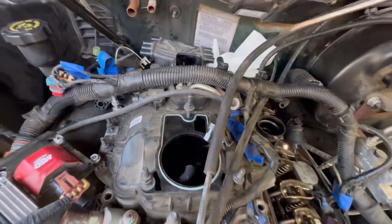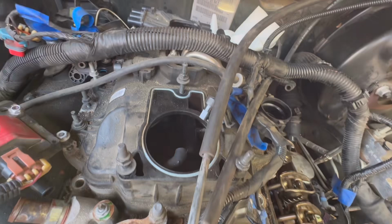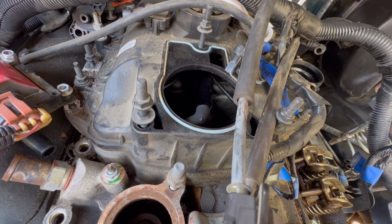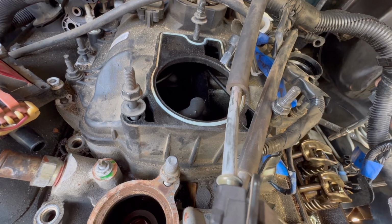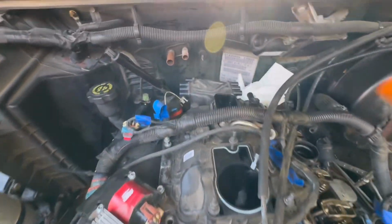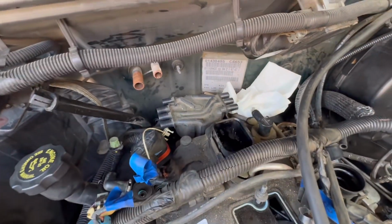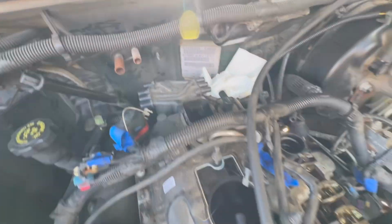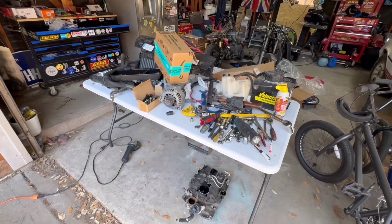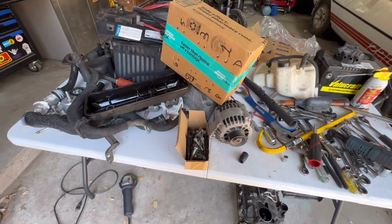So when you go to bleed the Schrader valve, what you want to do is, I don't know if I'm actually using too long of a screwdriver here. Let's see if I can get this one in here. It's probably too big. Yeah, we have to get a different one. Anyway, I'll get a shorter screwdriver. I put some paper towels down there because it will obviously let some fuel go. But once we get that bled, what we'll do is pull those other parts, and then I'll show you the next step there.